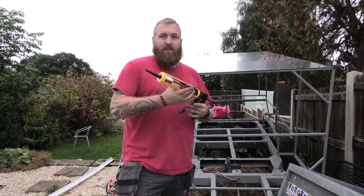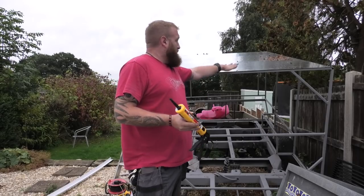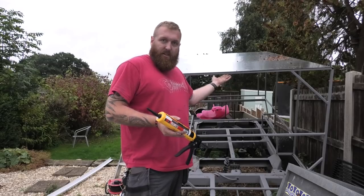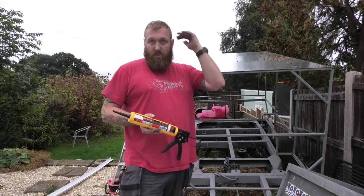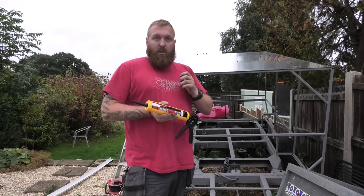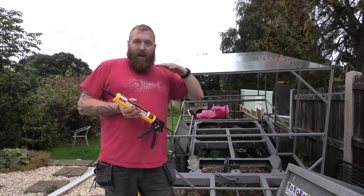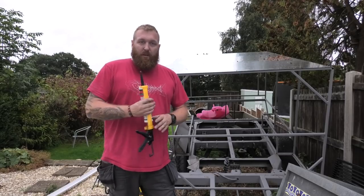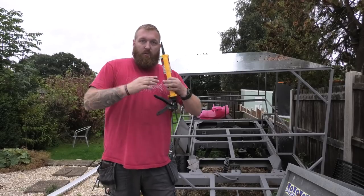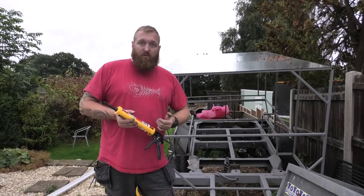So what I've just done there — it's a little bit excessive but in my mind, if this cuts down on vibration and potential water ingress. I've put the roof on, I've gone around the whole thing with silicone, dropped it on, then clamped it down. On the inside, everywhere where the painted steel meets this material, I've beaded all the way around and made it all nice and tight. That way you've got that extra bond on every single surface. Bear in mind this is made for off-road use — over thousands of miles of vibrations, things stretch. This is why you can't make these out of wood with screws, because over time any off-road rocking creates play and leverage, and you imagine a screw through two pieces of wood just flexing it over and over — it does make things come apart and let water in.